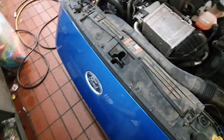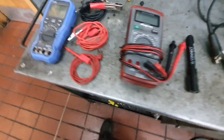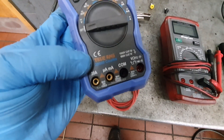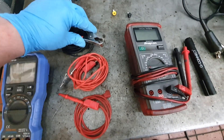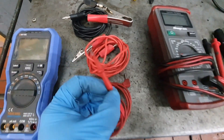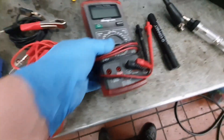With that disconnected, I'd like to show you the tools I use for the job. I have a multimeter that can go to the 20 amp scale on the amp setting. I use three different leads: a nice large crocodile clip, a small crocodile clip, and a back probing tool — we'll see why in a minute. The second multimeter is for volt drop testing across the fuses.